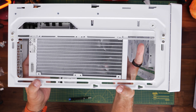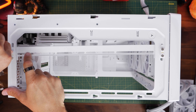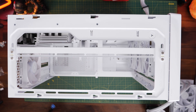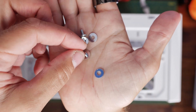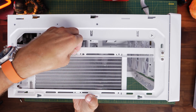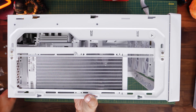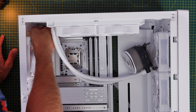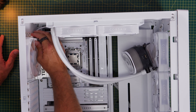Line it up with the brackets on the top of the case. This Corsair case has an InfiniRail system, so you need to adjust the bracketing by unscrewing and moving it over to fit the 120mm fan position. Use the small screws with washers to install the radiator to the top of the case — these are included with the cooler. It might be worth loosely installing these first so you can adjust the radiator's position, especially with a larger case that fits 360mm. Loosely fitting also allows you to shift the radiator and get your hand in to plug in the cables to the rear fan.